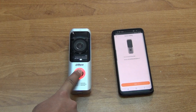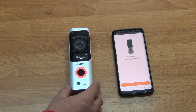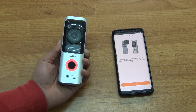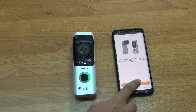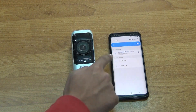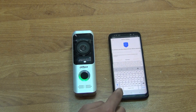Stage three is to set up the phone on the Wi-Fi network that the doorbell is emitting. After pressing the button, we can see the red light is flashing. We press the reset button on the back and hold it in for about five seconds. The green light comes on, meaning it's now looking for a phone to connect to. We can see the device appear and connect to it directly.